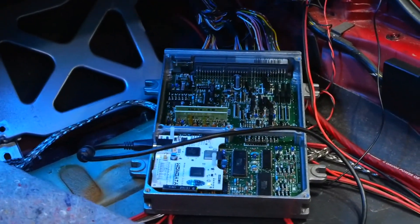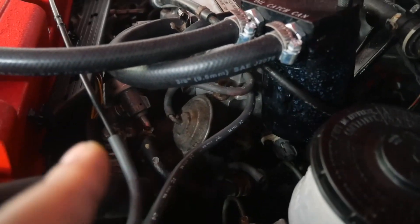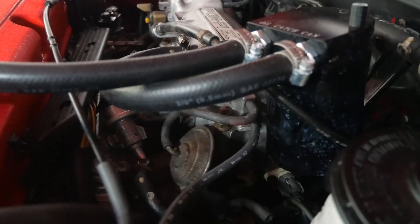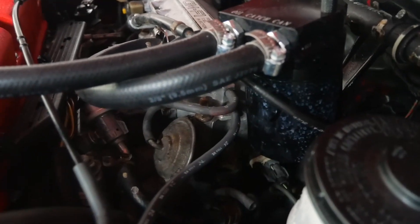It's a new day since I last recorded because I've been doing a lot of research and testing off camera. I just realized that my IAB butterfly system on the intake never worked. I tested the solenoid and I'm about 90% sure the solenoid is bad. I even tried the stock ECU and it still wasn't working, and that explains a lot — the low to mid range always felt a little weak but at the top it felt great.